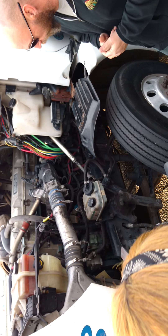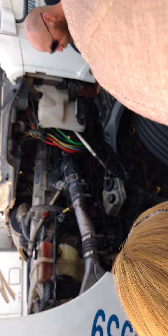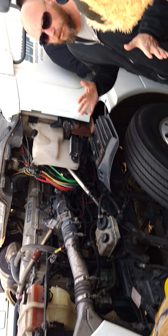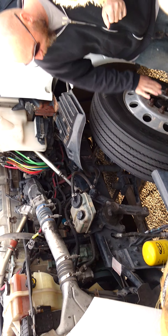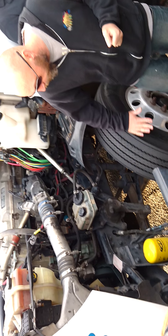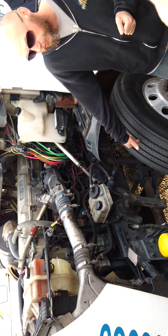The next thing I'm going to check is my suspension. My suspension includes my shock absorber, my shock absorber mount, my U-bolts, my springs, and my spring hangers. They can't be broken, loose, or missing — no cracks. Broken loose or missing works really well. If it's metal, I would use broken loose or missing.